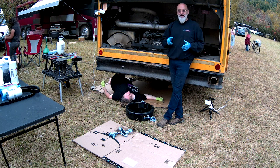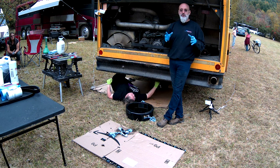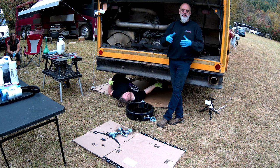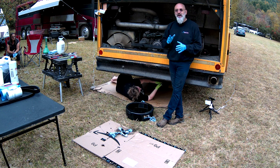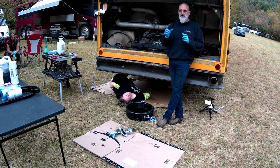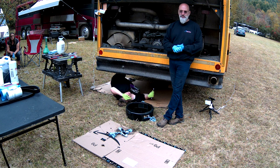Sorry, I know someone asked: where do you send this? If you go to any truck repair facility, they will have a little bottle and they'll send it in for you. There are kits on Amazon as well. But most of us are nomads and don't really have a good address to ship to. So go to any truck repair facility. They will have an oil sample kit. You take your oil sample, you bring it back to them, and you'll have a lab report within a day or two.